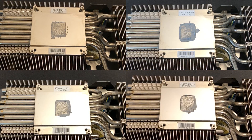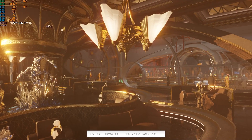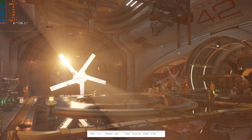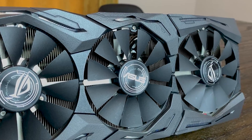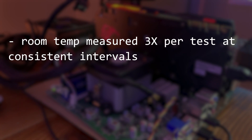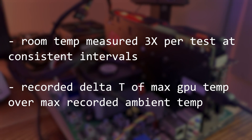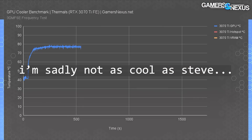After testing, I tried my best to remove the PCB from the heatsink in a perpendicular fashion so we could see how the thermal paste spread on the die. For each test run, I used the 3DMark Port Royal stress test, which runs the benchmark 20 times consecutively — plenty of time for GPU temps to level out. I used MSI Afterburner to lock the fan speed at 50% and raise the power and temp limits. I measured room temperature at the beginning, middle, and end of each stress test, and compared the max GPU temperature to the max recorded ambient temperature.